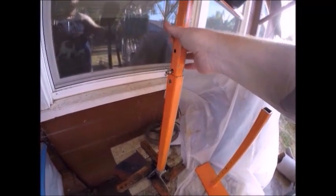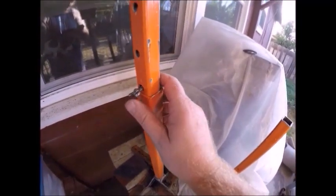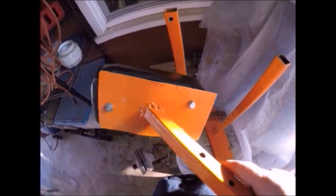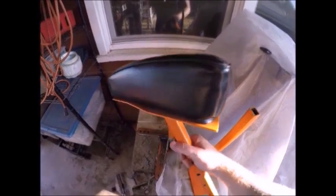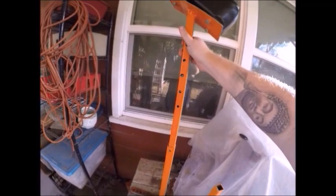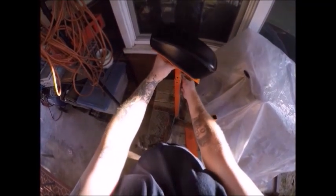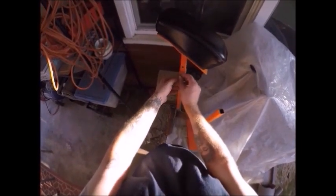Here is how this works. Put a smaller piece that slides into the big piece here with some holes, and then I just have a wing nut and a bolt here that allows you to adjust. I drilled 3 holes in the back of this and added some bolts so that this Harley Davidson seat would sit right on top of there. And now this slides right in and you can see the holes line up. Pretty simple operation here. I put it at the height I need, stick the bolt through, and put on a wing nut.